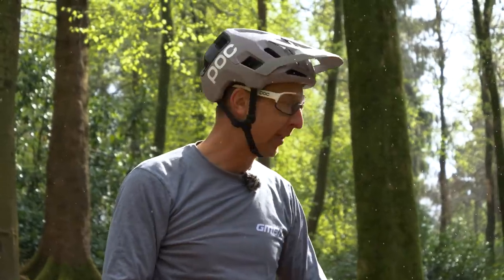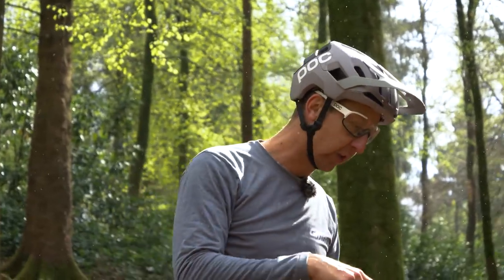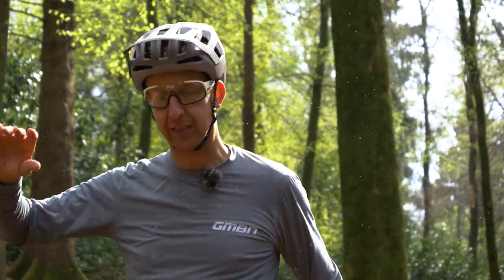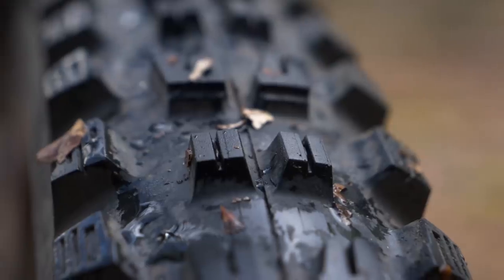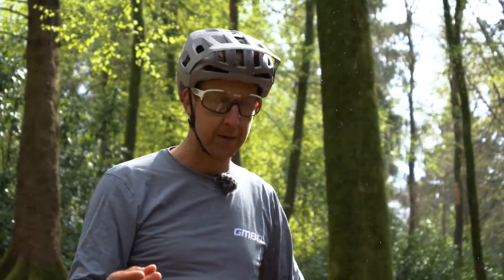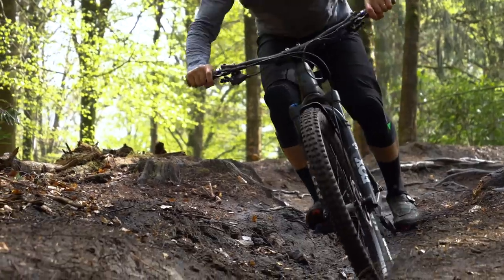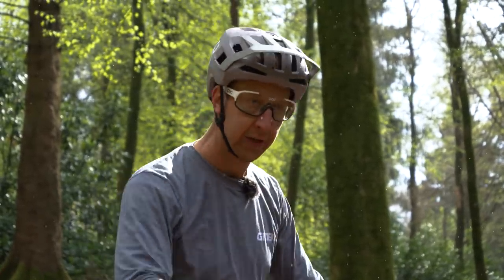The rain adds a little bit with traction — there are loads of wet roots everywhere which are slippery whatever you hit them on. The two bikes have different specs regardless: the other bike is from EMBN so it has different tires. The rubber on these e-bike tires is full compound, really soft and grippy, but weirdly I feel like I've not got as much grip. I can't work out if it's the tires and the feeling of the wheels on the ground, or if it's the heavy bike factor. The wheels on the e-bike are heavier and I'm running them at way higher pressure — probably 26-28 PSI on the trail bike versus probably 30-plus on the e-bike — so they shouldn't have as much grip, but that bike weirdly has loads of grip. It's a really strange feeling.